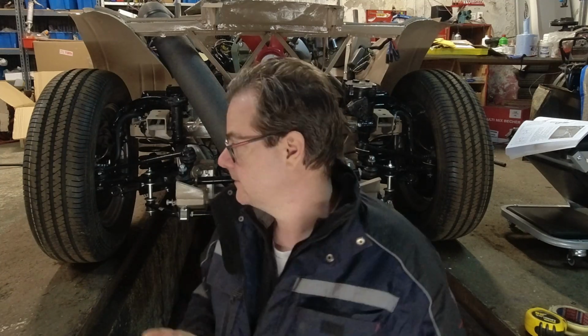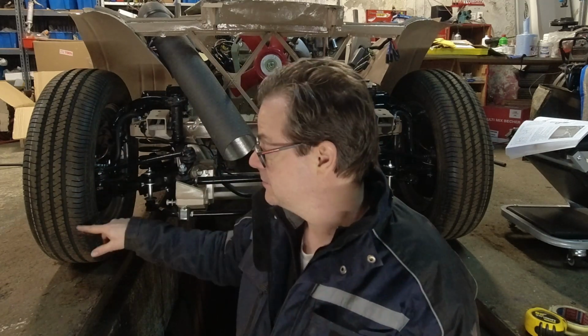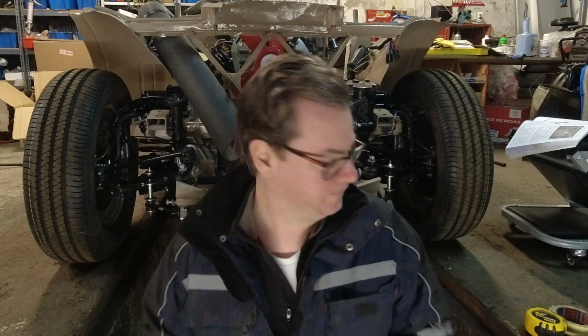One thing you need to consider though, there might be deformities in your tire or in your wheel itself. What the service manual suggests is you make a mark on your tire, take the measurement, roll the car forward until that measurement is in the back, and you take that again. That way it makes up for any differences in your tires or in your wheels themselves. So let's give that a try.